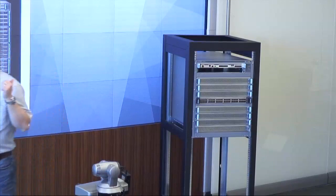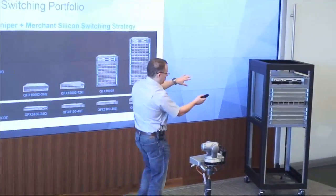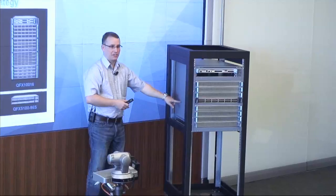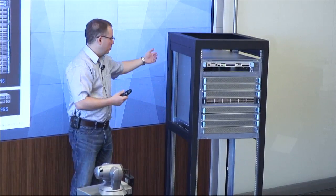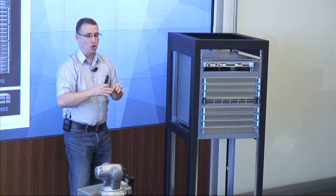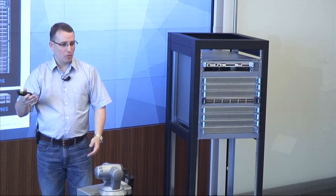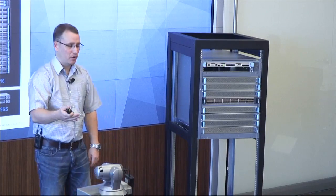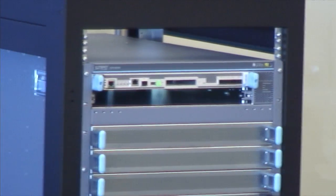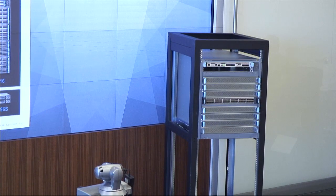One thing we did a bit differently here is we have something called an orthogonal direct connect, because typically when your line cards plug into your chassis, it goes into a mid-plane device. We got rid of that, because we found the copper traces in the mid-plane actually limit your expansibility. So when you plug in your switching fabric from the back, they pair up the line cards directly — there's no mid-plane whatsoever. As new line cards come out, whether it's 3 terabits per slot, 6 terabits, or 12 terabits per slot, as long as you have the correct switching fabric in the back, this chassis should last a very long time. There are no built-in limitations in terms of the backplane.